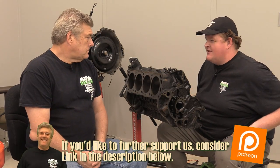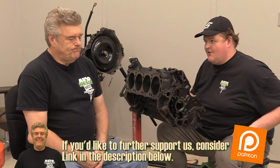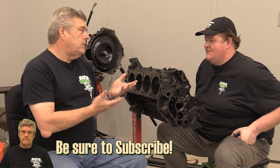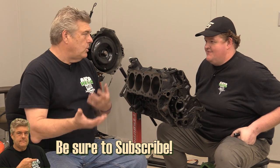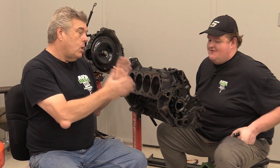If we wanted to spin this up to 6,000, 7,000, absolutely we'd get connecting rod bolts, but then we're going to be doing the roller cam as well. And again, it turns into the "while you're here," and all of a sudden you're going from a $400 parts bill on your rebuild to over $3,000 probably, because a roller cam ain't cheap. If you can find one. Their kits are about $700, which is more than twice what we have in parts. So we're just trying to make a nice pedestrian runner.